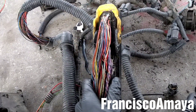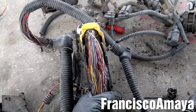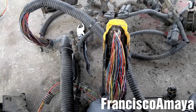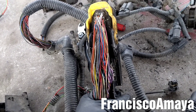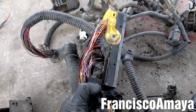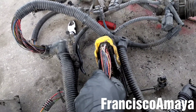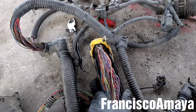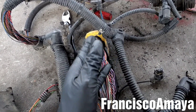The reality is it's not the oil. I know there are going to be some technicians and mechanics telling me that I'm wrong, that the oil is failing the engine harness. I've even seen videos saying that the oil is the reason. But it is not true. The real cause is that the wiring insulation wears apart from vibration, the conductors make contact with each other, and these problems start happening.